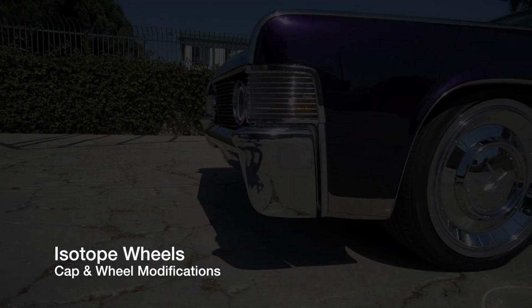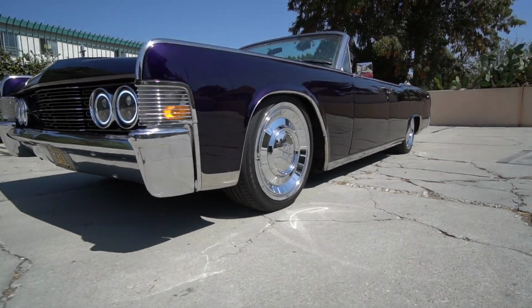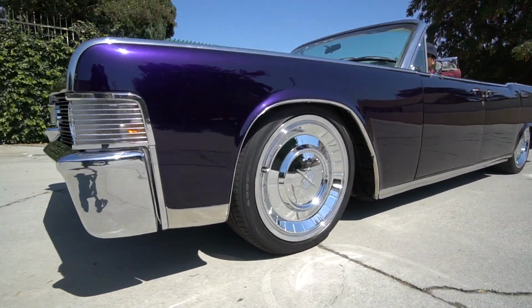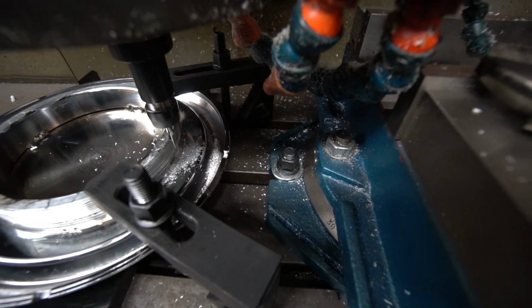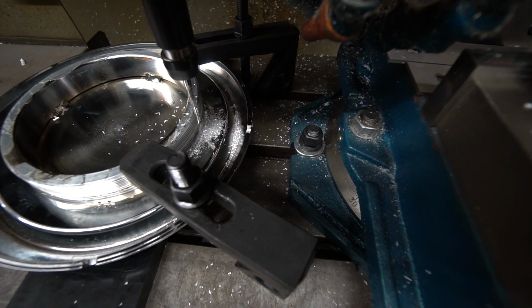Due to issues with the cap sometimes not being tightened enough or being too tightened and difficult to come off, we have implemented a new mechanical solution to lock in the caps. What we do on our end is to create a notch on the threads on the cap using a machine.